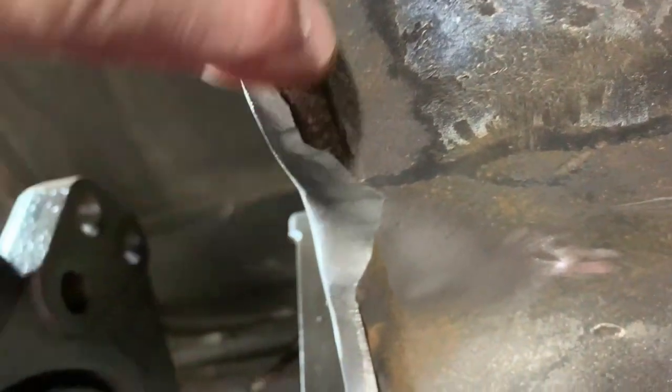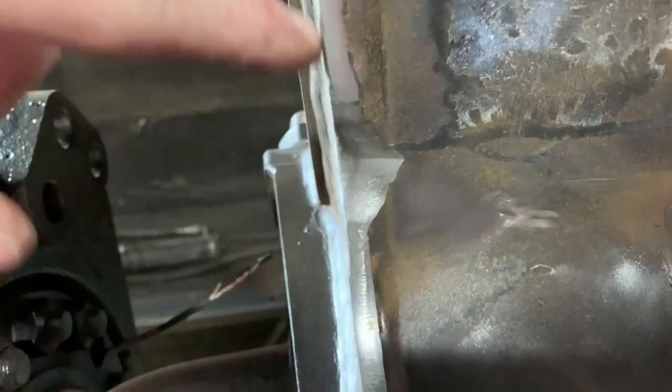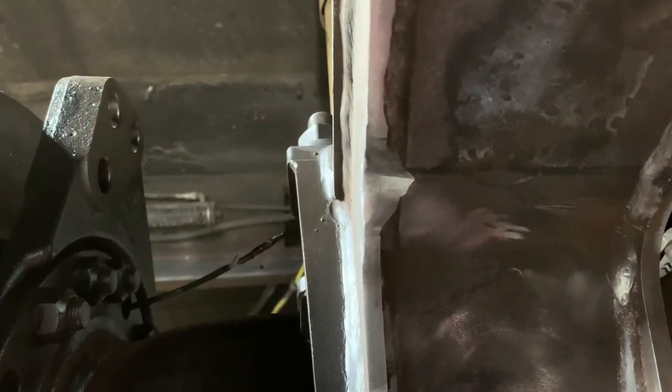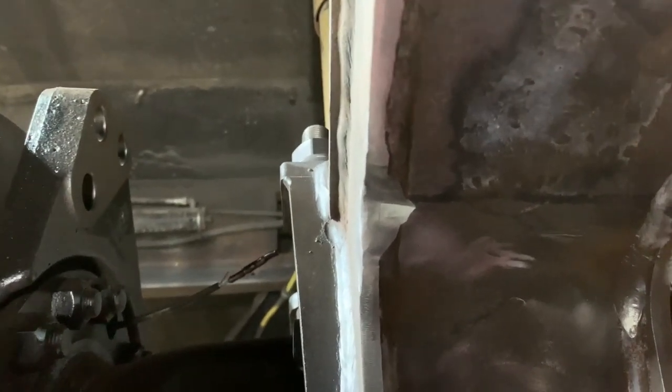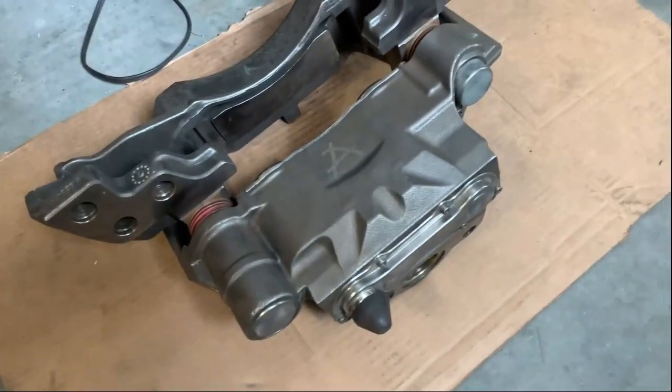As you can see underneath, it has not intruded into any structural member - plenty of clearance. You can see this web; it's a box section that's welded up all the way around. Taking this little piece of the web out has no significance on this structurally whatsoever. I'm going to put the caliper back on and show you the clearances I've got - both without the dust cap and with the dust cap. This is a caliper that's been removed and I've cleaned it up.